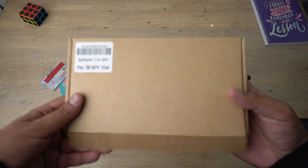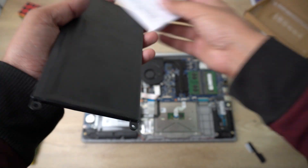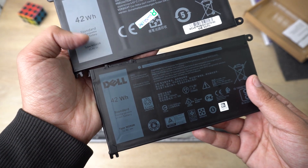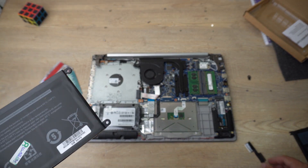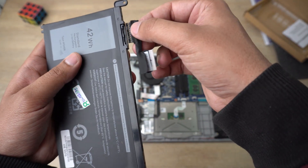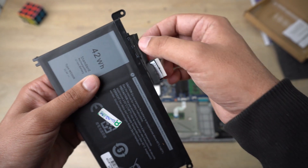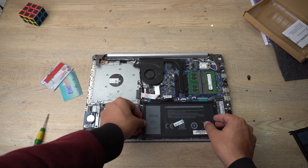Here is the new battery from my local store — same rating as the original for the Dell Inspiron 5570. Both are 42 watt-hour standard rechargeable Li-ion batteries, type WD X0R, 11.4 volts, three-cell. That's the key thing to match. Now we're going to reconnect the connector from the old cable to the new battery. Place it in the connector space on the top side — when you can no longer see the golden lines, the connector is fully seated.